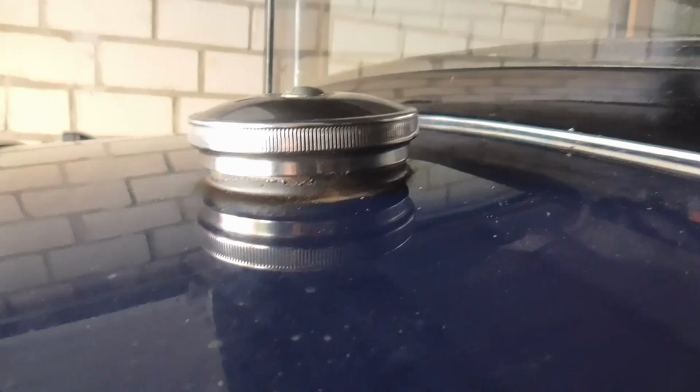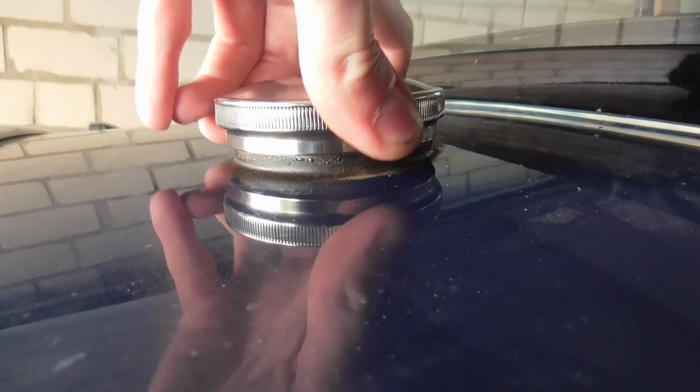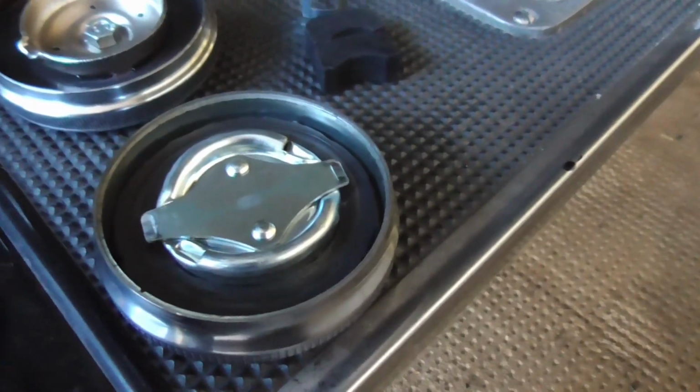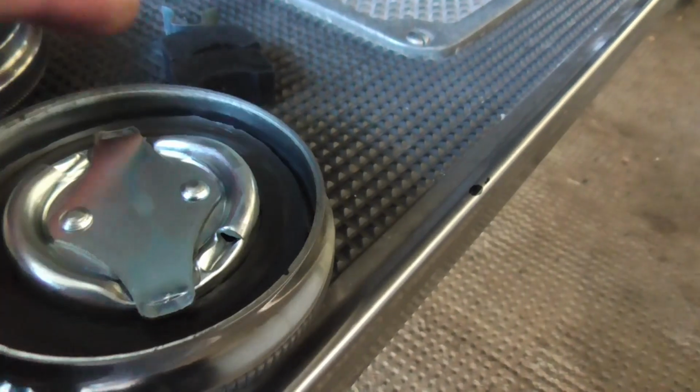One more thing that I learned in the meantime is that when you fill your tank to the brim, the petrol is not supposed to slosh all over the gas tank once you take the first right or left turn. You see, the gas tank has a cap on it, and the cap has a vent. And the vent inside is either of good quality or it's a bad repro. And if the gas cap doesn't even properly seat, there is no way to keep the gasoline in. However, if you have a properly sealing but venting cap, there shouldn't be any issues.